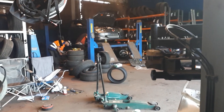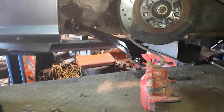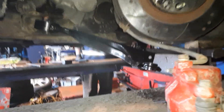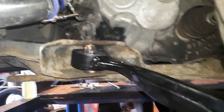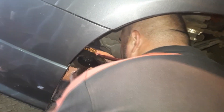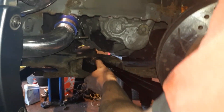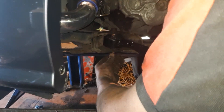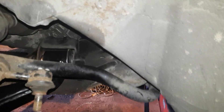Gilly's over there stripping the other side off. One side's already built up. Here we go with the old wishbone - just going to put the circlip side in first, it goes in a little bit easier. Copper greased it. All the bolts getting copper greased, Gilly? Yeah man - makes life easier. Got the bolt in the bottom - it's going in for the first time, no swearing involved at all. So we've got this side in.